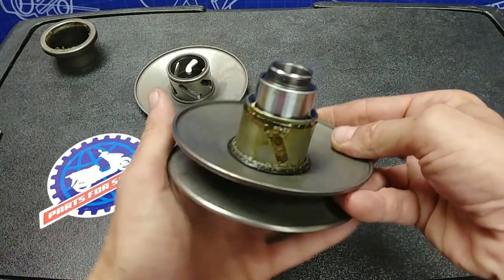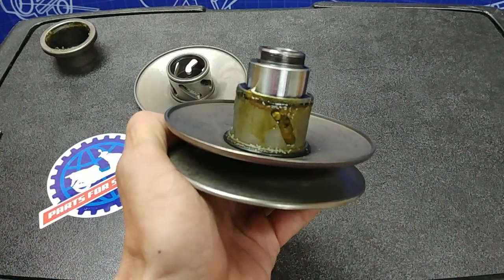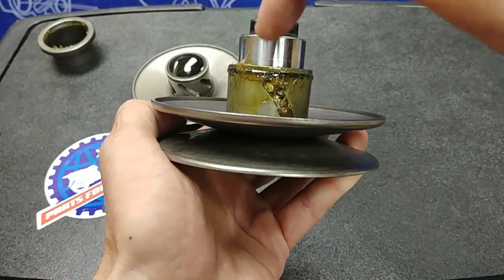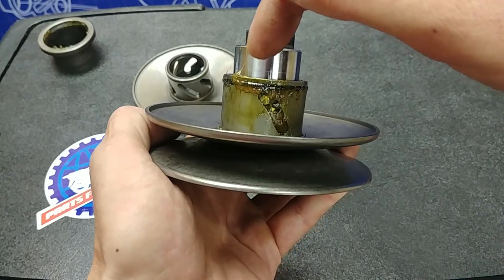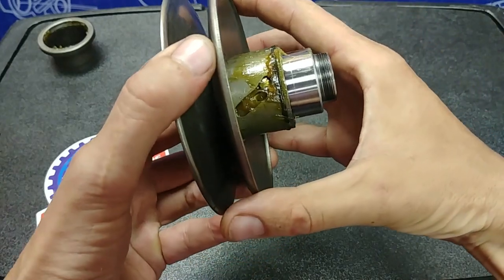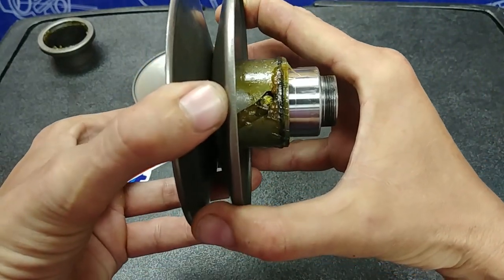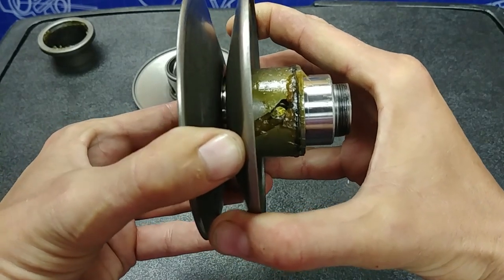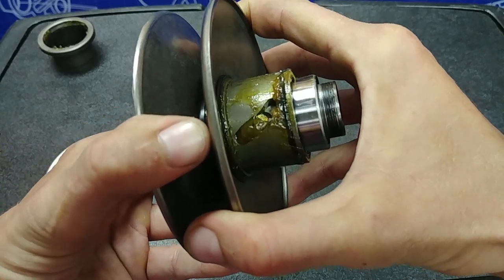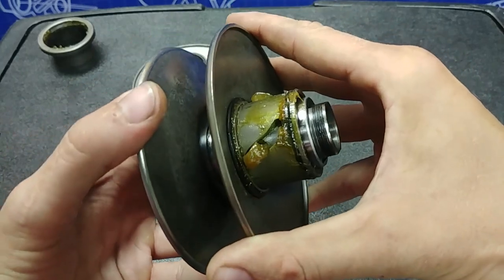Take a look at this stock torque driver and the angle of the groove. It starts, moves over, and then drops down. So with the clutch being at idle, you give it gas — this will kind of create tension and not allow the clutch to open very fast until you start to get up to speed, and then it'll drop in. This is almost like an overdrive, if you will.